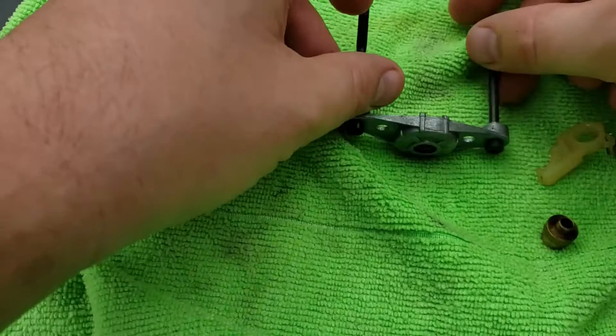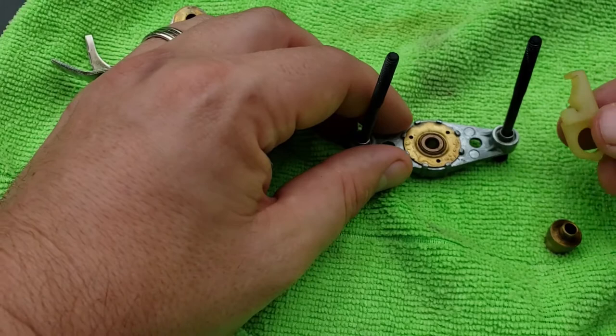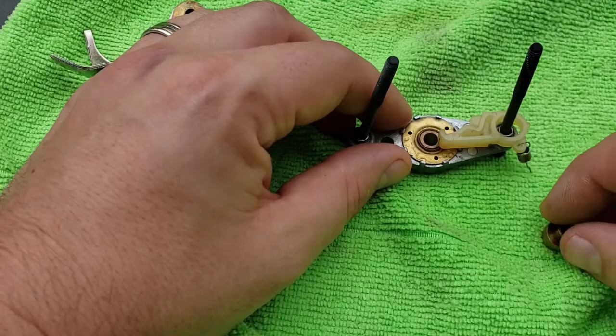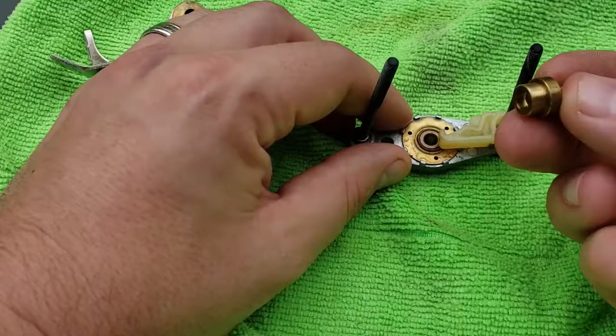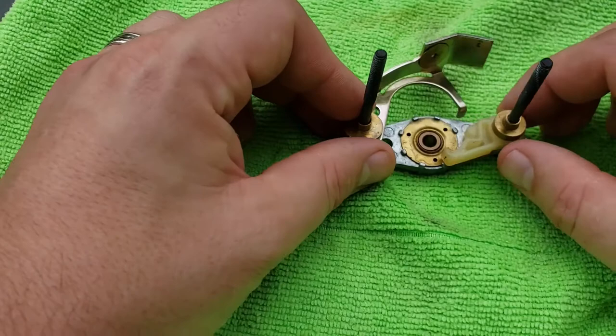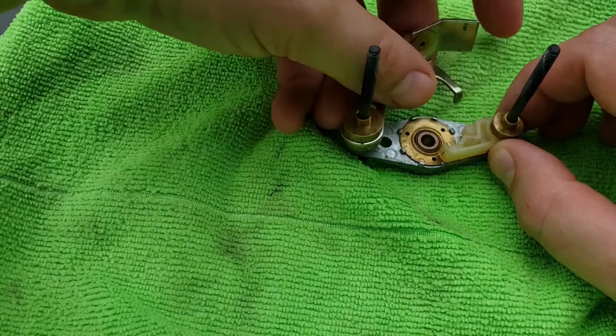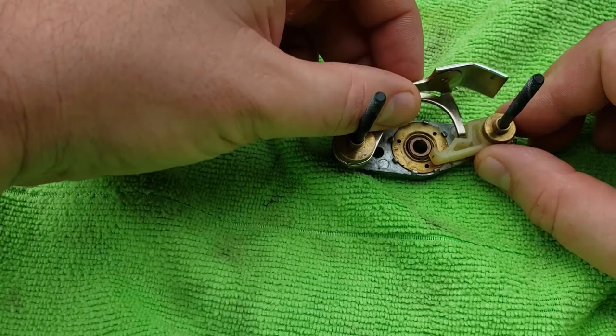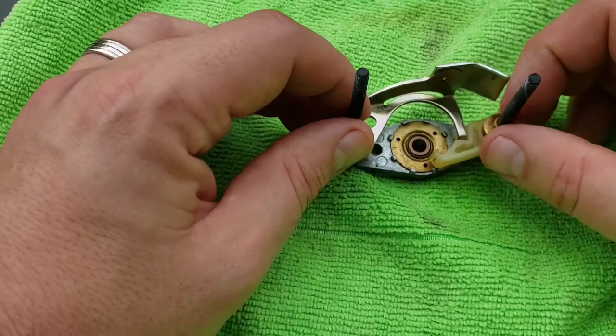For reassembly — I kept the screws with this because it helps to align everything and hold it together. There are two sides to this gear: this side and this side, which has a few more channels and passageways in it, so this is the side you want going down. The brass piece goes right inside. For the weight, put it on this way. There's a little tooth at the end, and you want to put it right in that slot so these two move together. When this weighted arm pulls down, the weight of it will pull that gear into place and park the motor.